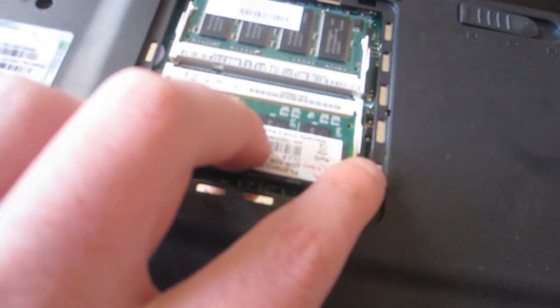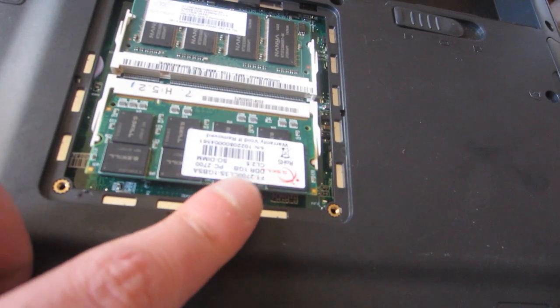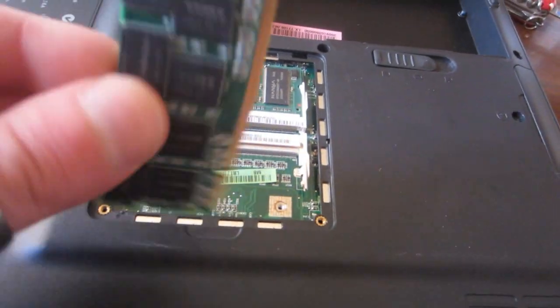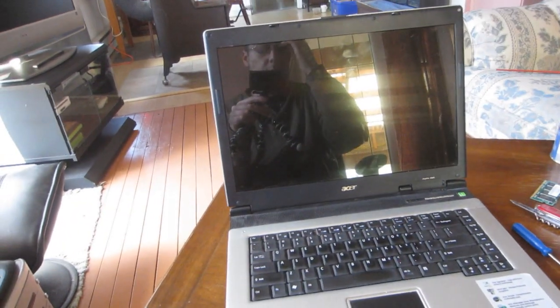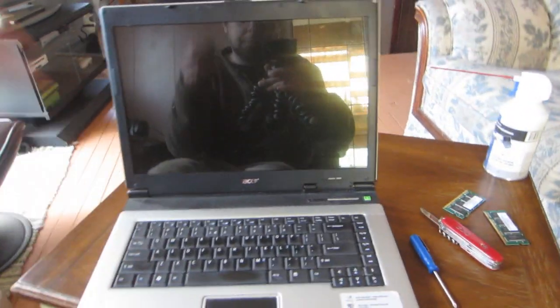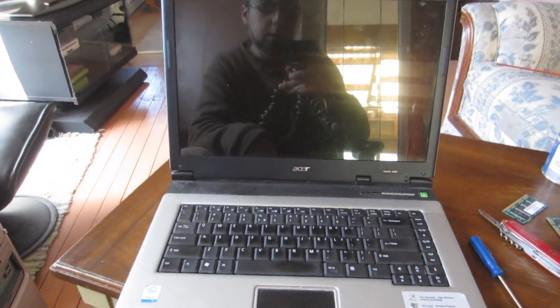To get the RAM out, you just pull these pins from each side — these white pins here — and the RAM will flip up. Don't try to slide it out until it's flipped up, then it just easily pulls out. So I swapped the RAM and... still nothing. I think what I might do is yank the hard drive out of this donor laptop and put it into the one I found, because all that one needs is a hard drive and it works. I'll talk to the client and see if she wouldn't mind that instead of repairing this one — I think this thing has motherboard problems, it's just old.